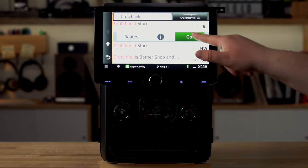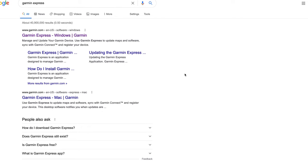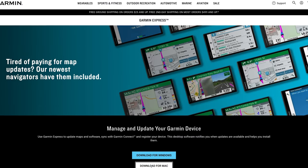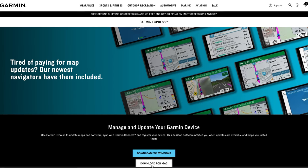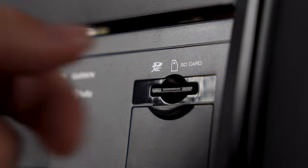Kenwood is smart — they've been partnering with Garmin for years. Garmin is kind of the king of satellite-based navigation software, and it's built in with all the maps of North America on it. You get three years of free map updates so you can consistently keep your maps up to date with the most recent additions and removals of roads. After three years, you'll have to pay for map updates. The way you get those updates is through the Garmin Express portal — PC or Mac-compatible software — and you simply put the map updates on an SD card and stick that into the SD card slot on the Kenwood radio. Keep in mind the updates stay on the SD card, which means it has to stay in the radio, so you won't be able to use the SD card as a source for audio or video files if you're using it for map updates.